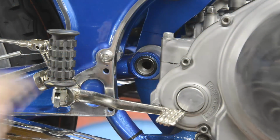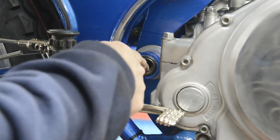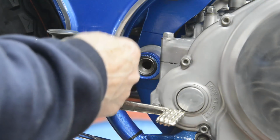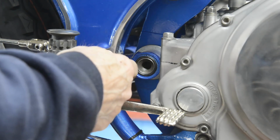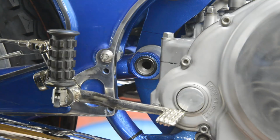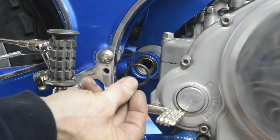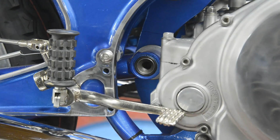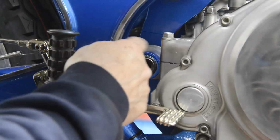Next thing we might as well do is the pieces that go in the swinging arm. Now, as I mentioned, this is actually lubricated with oil, like 140 EP gearbox oil. So there needs to be a seal on each end. So what we have is a thick O-ring at each end. Got one in here. Let me just shove this one in here ready. Then there are two discs, one on each side.